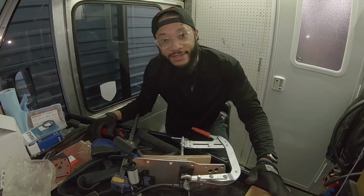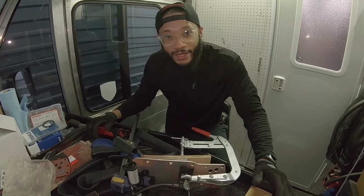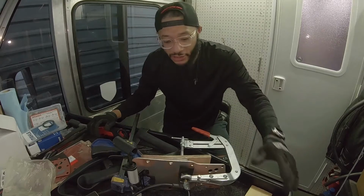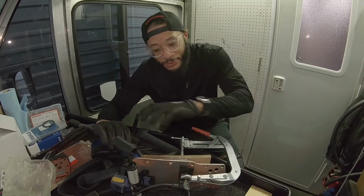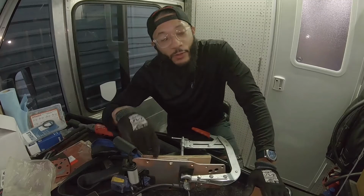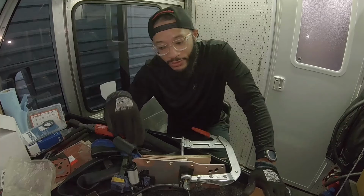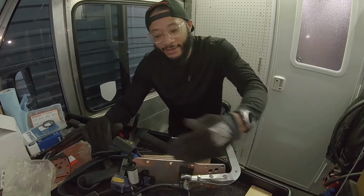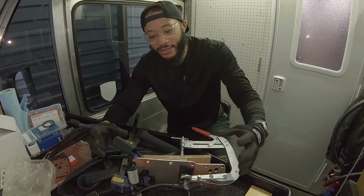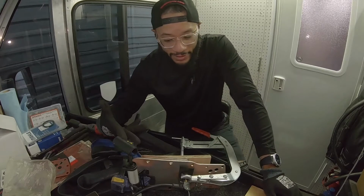Right now it's at 72 PSI. Want to aim for 70. You want to kind of imitate oil pressure. If you had built a better contraption, or once you replace the old one, you could probably rig up an actual test plate by cutting off the bottom piece of the cooler and some rubber, and then sandwiching that together, then actually bolting it together. But this setup works pretty good.